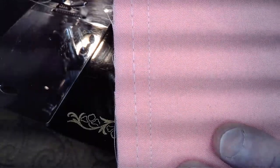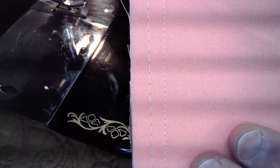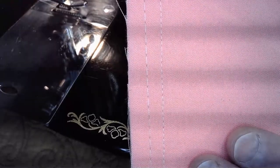There's so many things that play into the quality and the consistency of stitching that when you go through a stitch length variation like this, of about 6 stitches per inch all the way down to about 20 stitches per inch, it really puts that machine to the test to see if it can maintain stitch integrity and stitch quality. And obviously, Kathy Maddox's 1949 Singer 1591 out of Canada did a brilliant job. It's exactly what we want to be seeing as far as stitch quality and stitch caliber.